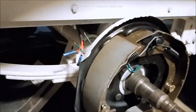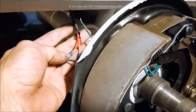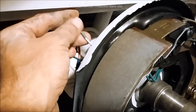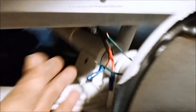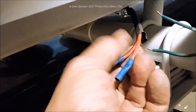Let's get this one bolted on and we'll go to the next step. Now as far as wiring up your brakes: one of them goes to ground and one goes to the blue wire generally coming from your brake controller, whether it's a 5, 6, or 7-prong outlet. You can put this to a ground as close as you want, or you can go back like I did to the junction box and run new wires all the way back so they're all equal length.